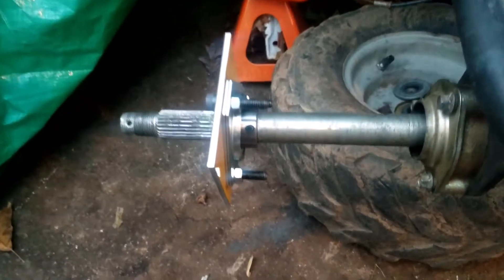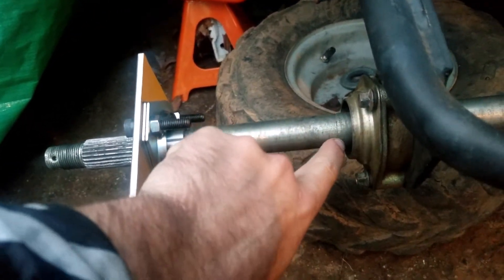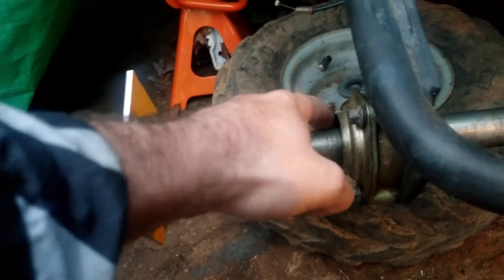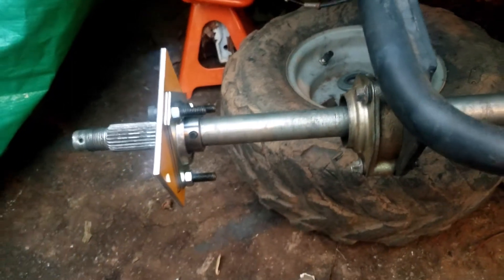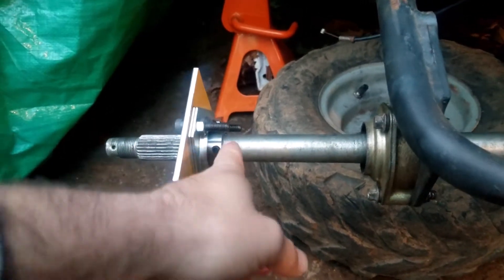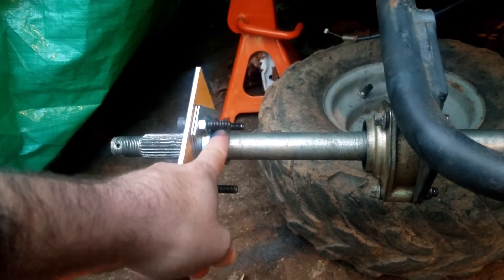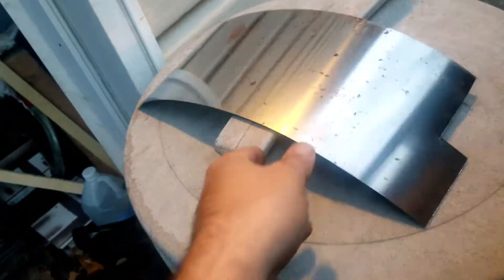By the time it gets out here, I haven't measured it but I know it's less than 25mm because there's a slight step there that goes up to 25 — you can barely feel it with your finger. It's probably like a millimeter difference. I didn't realize there was a step there at first, so I had to make some very thin spacers to put between the axle and the bearing to get a tight fit — no slop. I used shim material, cut strips and wrapped it around the axle to take up that space.